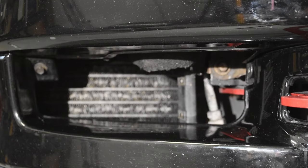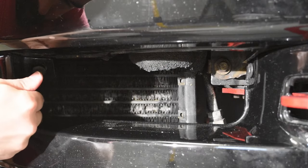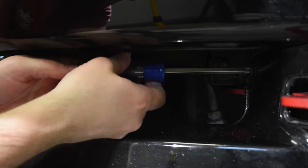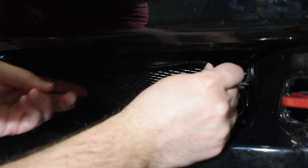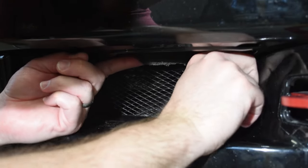Moving to the car, step one is to remove the two fasteners and possibly the curved deflectors that would normally attach here. My bumper doesn't currently have these, but you'll know during test fitting if you need to remove them on yours. Taking hints from the instructions, I inserted the outside end first to get the whole screen into the cavity — an act made easier by having rounded the two lower corners. In my case, it was necessary to push some foam out of the way to achieve initial orientation.